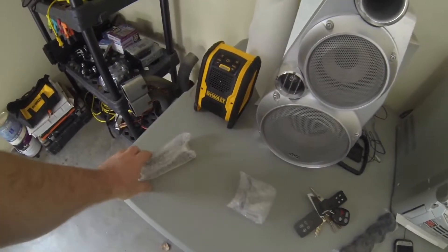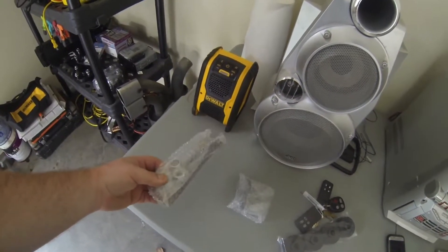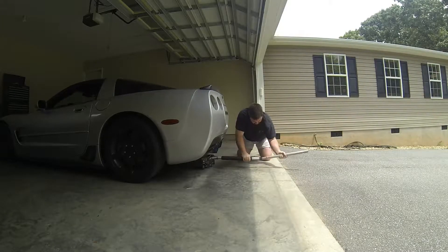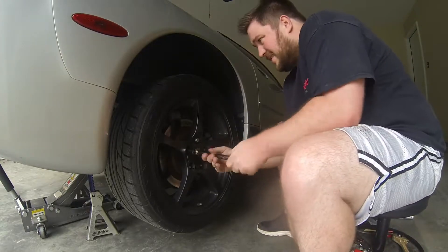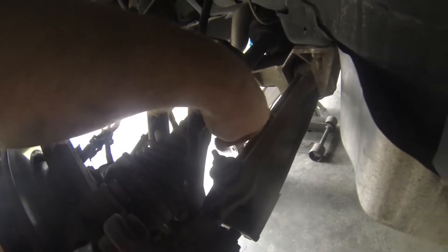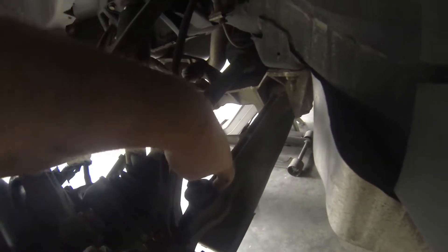Got the fronts and then the rears, and then the rubber at the bottom. So obviously you need to take off your wheels. Let's take a look at the bolt and show you what's going on. What you're basically doing is taking this C-clip off right here at the top of this bolt, taking this bolt off, taking this nut off, and the bolt should fall right out of the bottom. I think it's a 19 top and a 19 bottom. You're going to replace the bolt, nut, and the bushings with the kit.